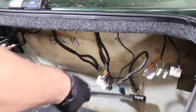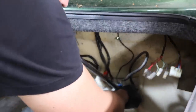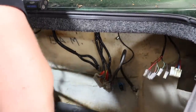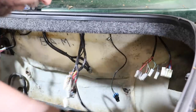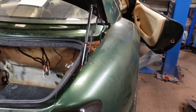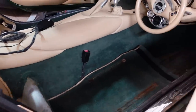The two rear body bolts are located - one here and one there. They're a bit more internal, so I'm hoping they should come off okay. The fuel tank is all out and the two rear body bolts are now removed. I've also disconnected the seat belts, apart from one that's right under the carpet which I'll need to rip up to reach. The rear anchors are undone on both sides, so we're in a pretty good position.